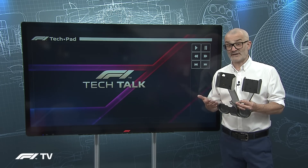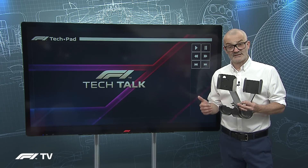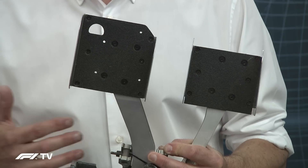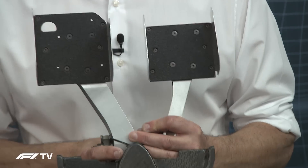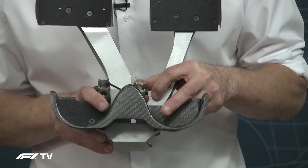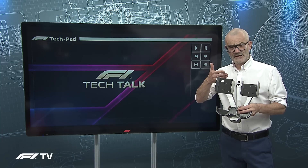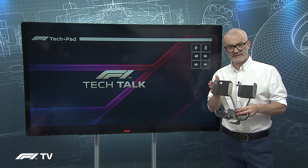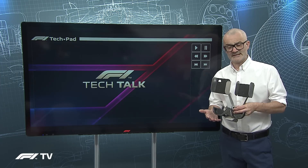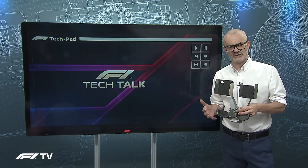Safety is very important — you don't want a pedal failing while you're out on the track under any circumstances. Then you have the driver's side, which is split into two aspects: comfort, and the leverage that is applied through the pedals. For comfort, the driver has a pair of heel rests down here so the back of their heel sits in, keeping their foot steady even over bumps and curbs. The height of the pedal and the side faces are all customised for each driver, and they'll also be positioned front to rear in the car slightly differently.